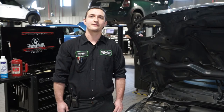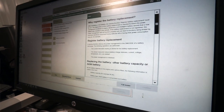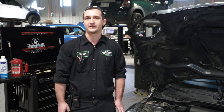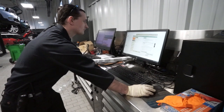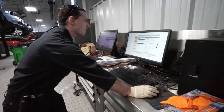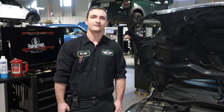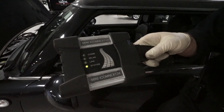After we replace the battery, what you're going to need to do is actually register the battery. On these vehicles, the power management system needs to be informed that a new battery has been installed. Cars are so complex nowadays — some cars can have up to 14 or 15 different computers. The car needs to know what kind of battery is in it and how it will act. If the battery is not registered after replacement, it can prematurely kill the battery.